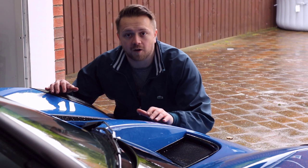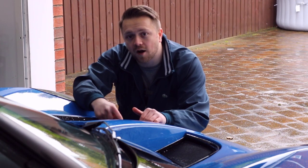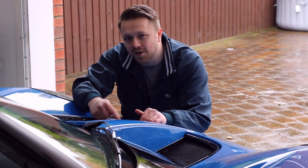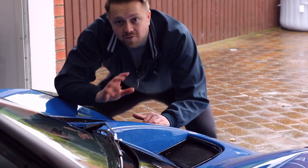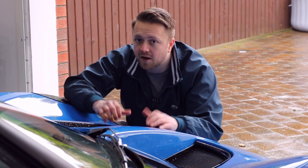Next stop, front of the car, because the radiator actually sits under here on these cars and due to that positioning, it can be prone to both damage and a bit of corrosion as well. So make sure you get to the front and get a look through this venting to make sure everything looks okay. If it's got an aftermarket aluminium or stainless steel one, even better.